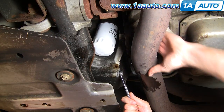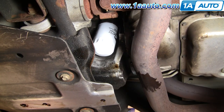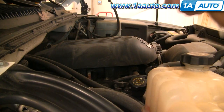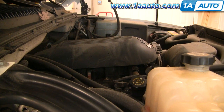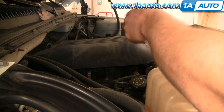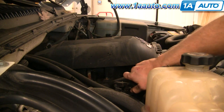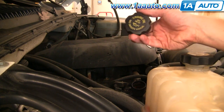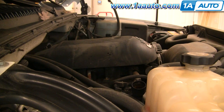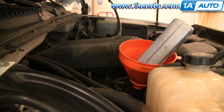Get your 15mm wrench again and make sure that the plug is tight. Now take the dipstick out and wipe it off — just get any of that dirty oil off it. Then take the oil fill cap off, and on this truck it says right on it: 5W30. You can also check the manual — your owner's manual should tell you the engine oil type. Now, right where that cap was, you're going to add in five quarts of oil, and then check the level.